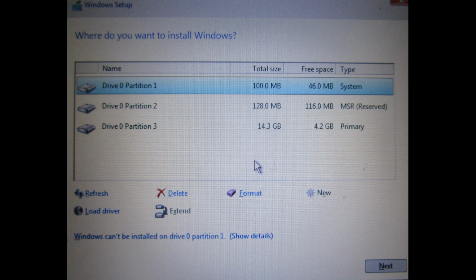Now for a full install, you're going to need your Windows 7 and Windows 8 serial number, which do not come with your PC anymore. You have to use a utility to extract it. Or Microsoft will recognize your previous hardware as a registered product and go ahead and give you a new serial number. Now, if you bought this as an OEM, in other words, if somebody else made it, it has an OEM license, it can be installed on the same machine. It cannot be installed on a different machine. Same if you built your own system, and you can't reuse an OEM unless it's on the same hardware. Now, since you're doing it on the same tablet, you should have no problem. Even if you do a fresh install, Windows will recognize your hardware and give you your proper serial number.